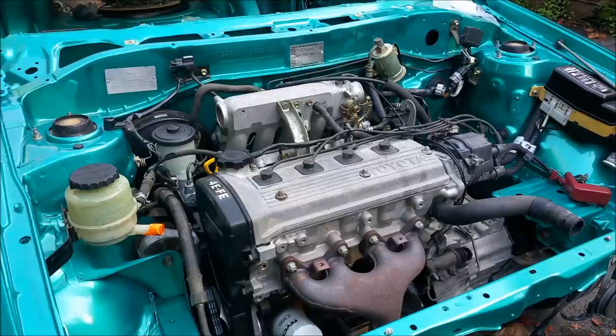Some older cars, like VL Commodores, I think it was, that used the RB30 engine, had a self-diagnostic facility on the computer itself. It just had a red and a green LED, red for tens, green for units, and it would flash codes almost like Morse code, and you would read them off. Whereas these vehicles and anything subsequent to this, as far as I'm aware, use specialist equipment to read it.